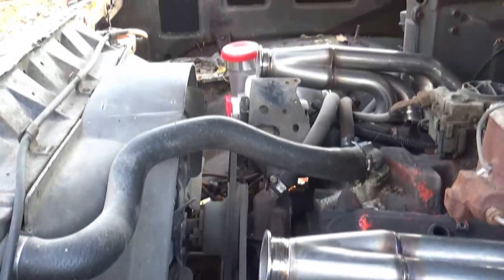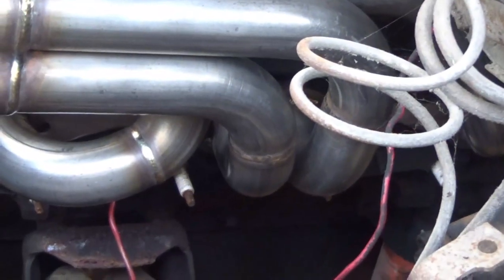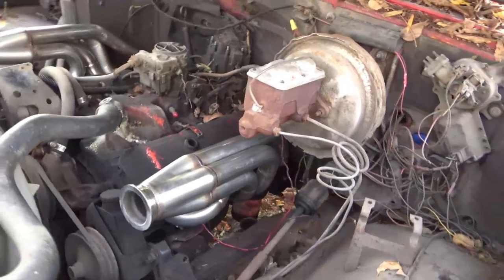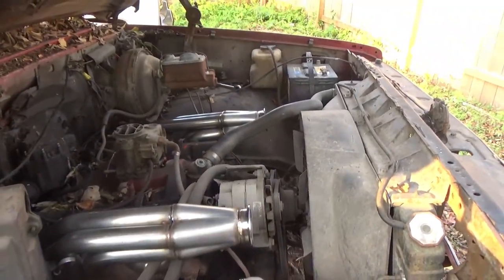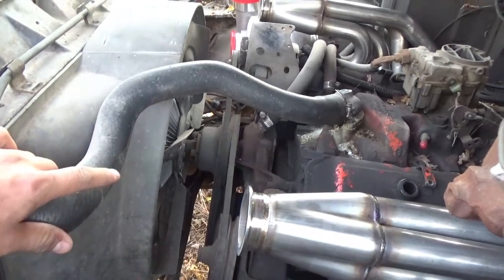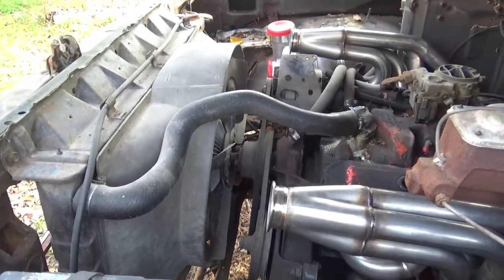Here's a side view of about where it would line up. One thing I want to point out that's awesome - you have perfect access to the spark plugs. You just kind of have to reach over and under them, but you actually could get a socket on there real easy. That's actually pretty nice. My plan is to go across up high, pretty much just directly straight across. It would have to come out a little bit, but as you can see, that's going to interfere with the fan, the radiator hose, and whatever. I kind of anticipated that - I knew I was probably going to have to run electric fans. But on a full-size truck, it looks like you could probably do that without relocating the radiator at all.